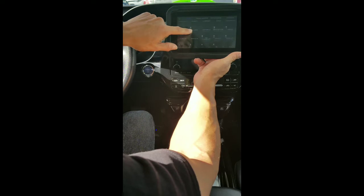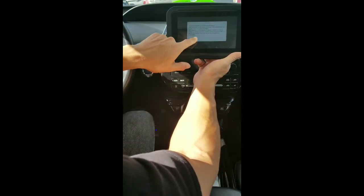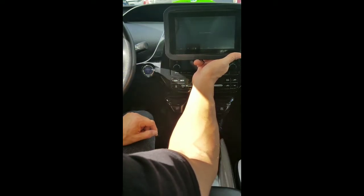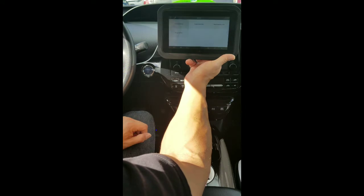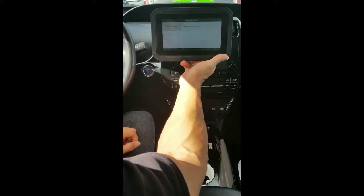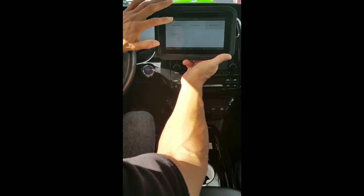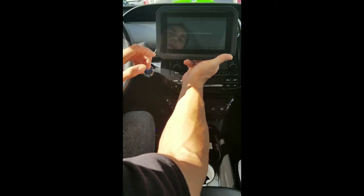I'm going to find US Toyota, then jump right in. It says Agree. Alright, smart key system — we're going to go to Prox 3. I'm going to go to reset smart key ECU because I'm trying to add a used key. Actually, let's go ahead and try to add a smart key first because maybe I do have a newer one — let's try it out.